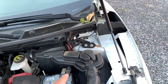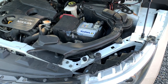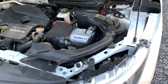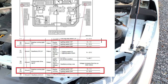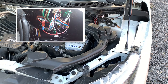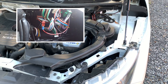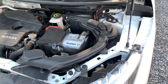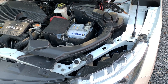Recall that I fed a cable through earlier — this was the reason why. Before wiring up, we should know what kind of power source we're going to use. Here again there are multiple solutions. Tigrimang used one of the DRL ports — port 51 and port 57. He bypassed one of them with a Scotch lock connector: you just clip them on, wire through your cabling, and you're done. As I'm going to wire up to both tail lights in the IPDM, I have to use a different approach.